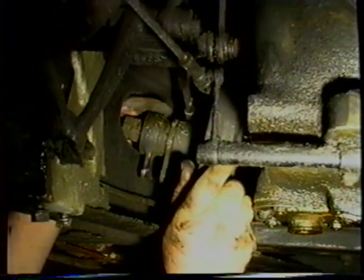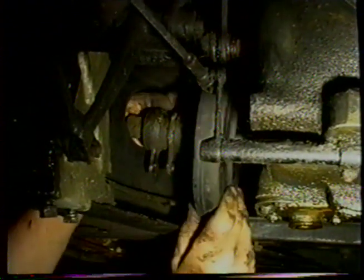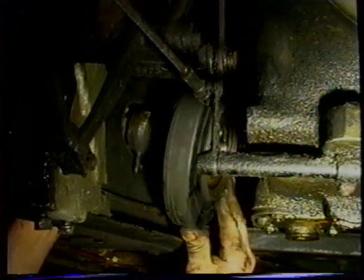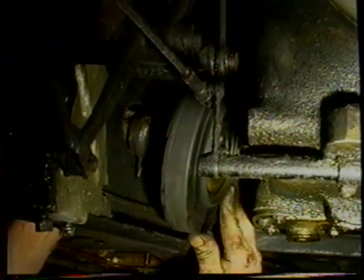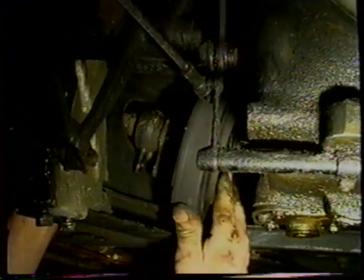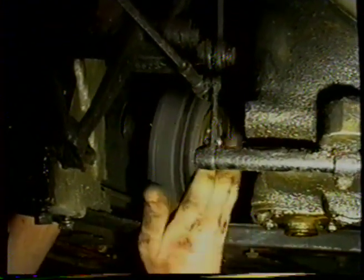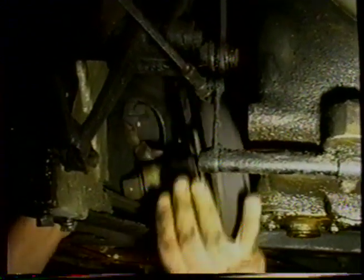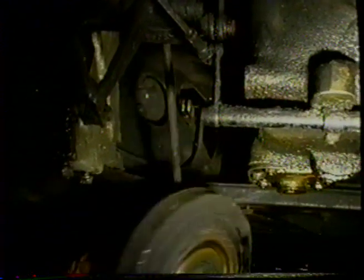Take it forwards. Now you want to be very careful at this point not to damage the spring cover on the pins that stick out. So it takes a little bit of maneuvering, especially with this one, because the engine's out and the servo and the gearbox are a little tight to the chassis. We managed that there. We didn't have any damage, and that's the servo down.